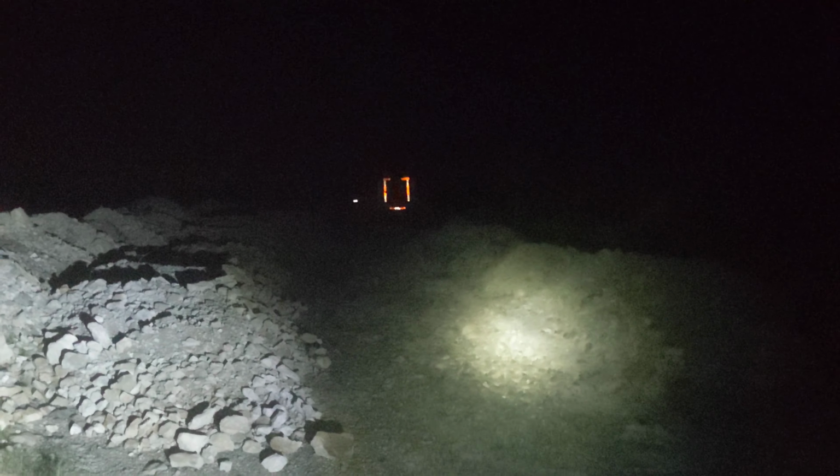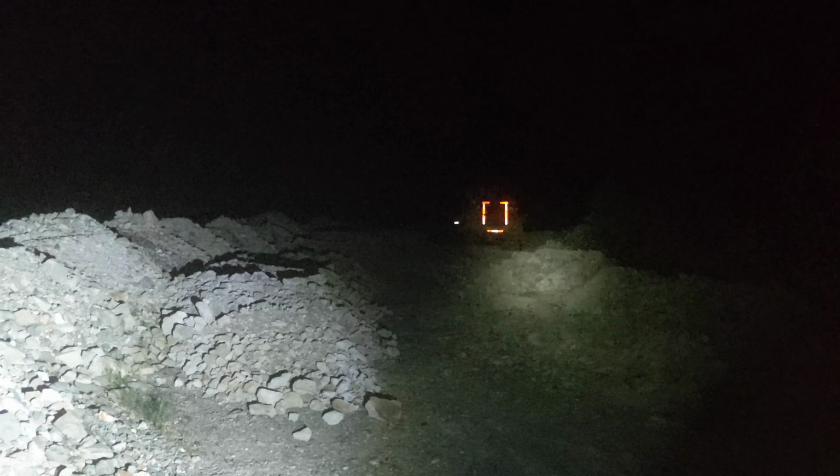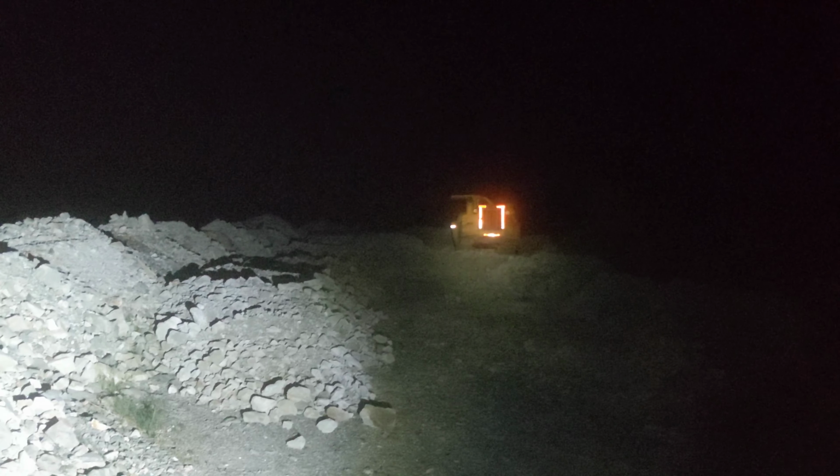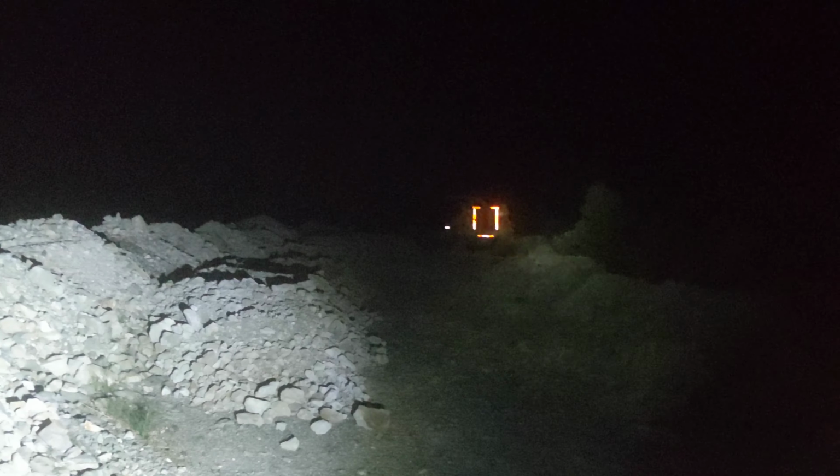With that, we are set up for, hopefully, success the next time we come up here to operate. Face is clear. We're ready to start pushing off the dump. We do that with the 913 because it's the biggest machine we have access to. It's got a lot of power, even though it's smoky, clunky, bad visibility, spooky to run. It does have power. So we use it to push all these loads off. And what we're doing is we're headed towards what's eventually going to be the collar of an escapeway shaft that's directly over our ore body.